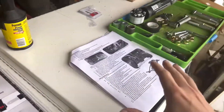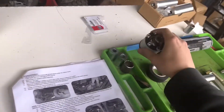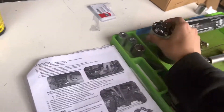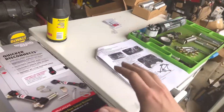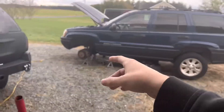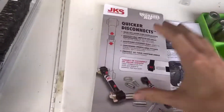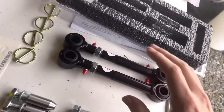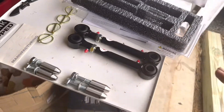While we wait for the extra bushing missing for the front three-link on the Grand Cherokee — they accidentally sent a flex joint instead of one of the rubber bushings — the rubber one will ship Monday so we'll get it mid-week and wrap up the front. In the meantime, I'm going to install these JKS quick disconnects. These should be relatively simple, but I'm not sure on the final length yet since the Jeep's not on the ground under its own weight, so we'll adjust once the full lift is installed.